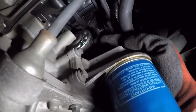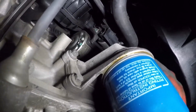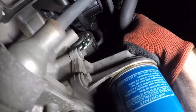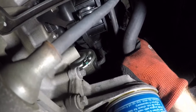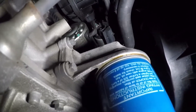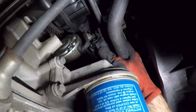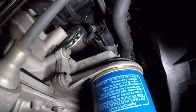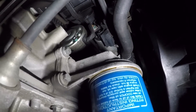We are looking at the starter motor right there - that's the back of the starter motor. Our main power feed is just up here where my finger is, and the actual trigger wire to start the starter motor going is just a connector up here, but we'll look at that when we get back up top. We know that the body of the starter motor is connected to the engine block, so this should be a ground all the time when nothing's happening.